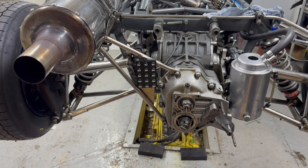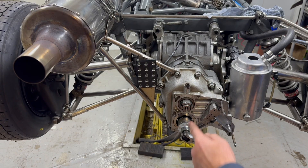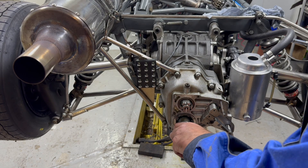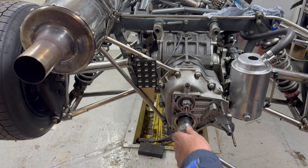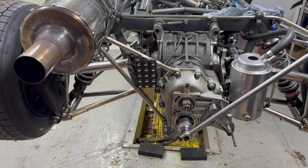I said I was going to use the back of the gearbox just to turn the engine. This shaft here goes straight through to the engine, so all I can do is turn the back here to move the valves up and down. It's just a convenient way of turning the engine really. We'll get the feeler gauges and check the valves.